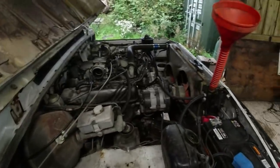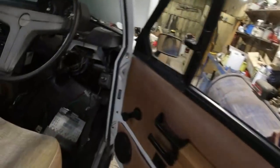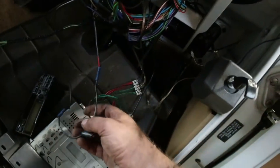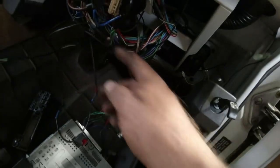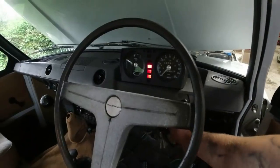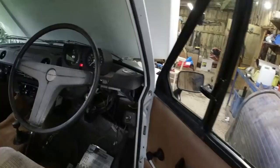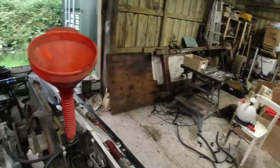It wouldn't start. Right. Why wouldn't it start? Well, there's no fuel. No fuel was coming up the fuel line whatsoever. We've got an electric pump on this car. And then I remembered this little bundle of joy down here, which goes through a fuse, through a couple of crimps and so forth, and eventually ends up on the white ignition control circuit. So, should we try it now? I don't think you can say fairer than that, can you?